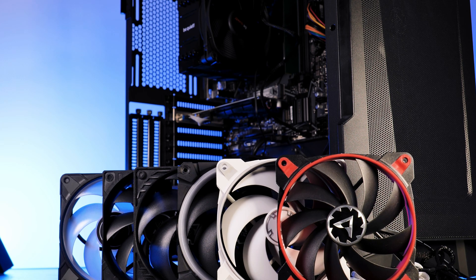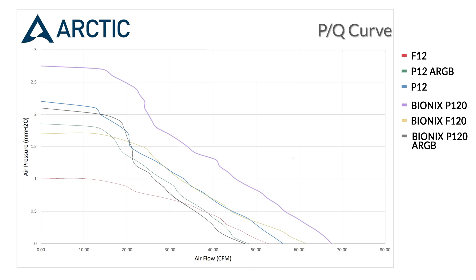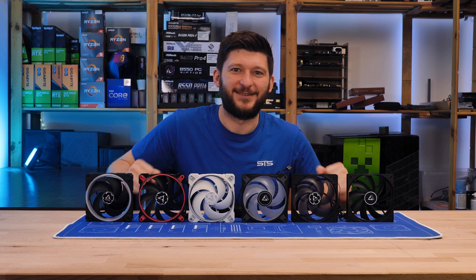But before you think each Bionix is just a regular fan with a bit of extra performance tacked on at the end — it is not the case. There are many tiny differences between regular and Bionix fans that prevent you from streamlining anything between them. The best place to see that is on their PQ curve. These curves show max fan speed, and if you scale an F12 graph up to fit an F120 Bionix, you simply can't do that. So a Bionix and a regular fan are not directly comparable — we need to put them through the same rigorous testing. More bench rounds.